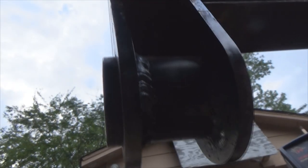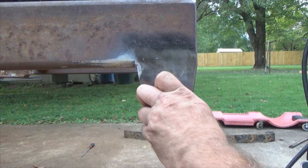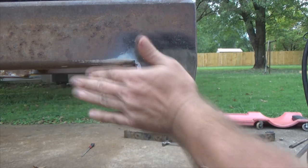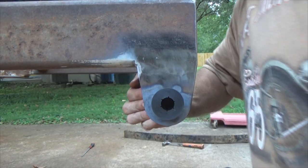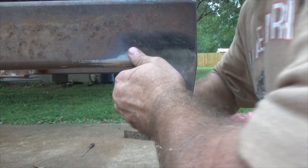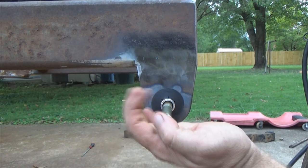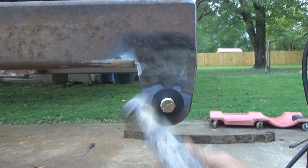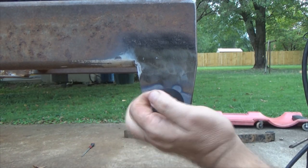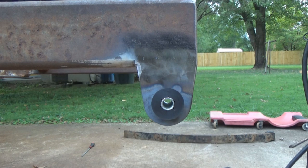Putting in your second tab right here keeps everything proper. I'll bring my beads to the inside, got them welded in good. That right here is still hot — yes, that's cooled off. So it's time to put the bushings in here. To put the bushings back in, just simply take them and slide them in. Of course, when I get ready to paint the frame I'll be pulling them back out and greasing them after painting. Put the sleeve back in, put your bolt in first and hit the bolt with a hammer — you're less likely to booger up the edge and cause it to catch.